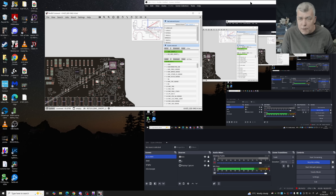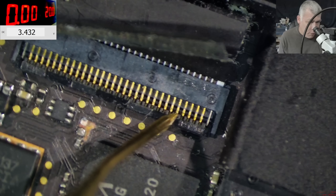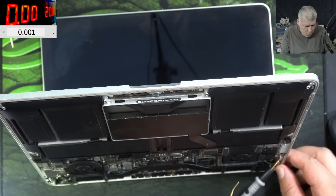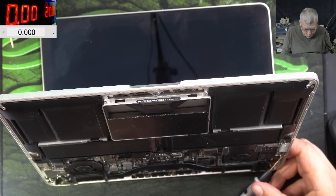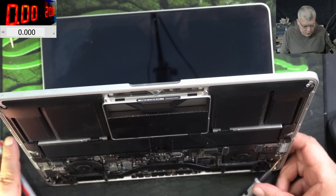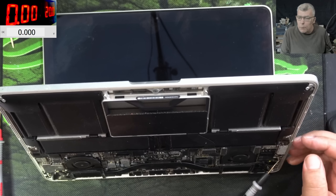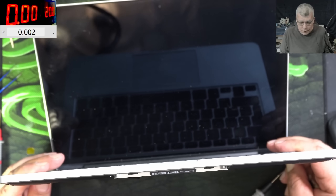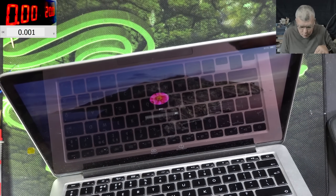Pin number five: one, two, three, four, five. This one has 3.4V, but when I'm pressing the power button it should go to zero. The problem is I have to hold the laptop open for the laptop to power on. Pressing the power button is doing nothing. So if I'm shorting that pin to ground, the laptop should come on — and the laptop is on. Definitely the keyboard power button is not working. And the liquid damage from the board actually has no connection with the fault.